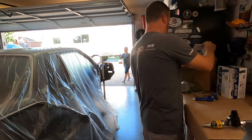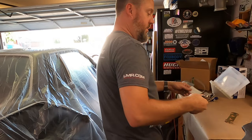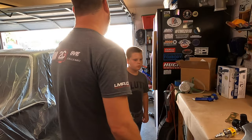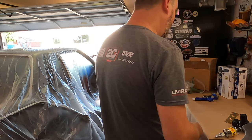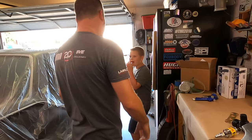What's up, man? What are you doing? Setting up this. Is that paint? That's a paint gun. Cool. Yeah. Snack rack? Well, it's nothing in it right now, but... Oh. Yep. Setting up the paint gun. We're shooting epoxy on. What color? Oh, it's just gray primer. Oh. But I've got to shoot the engine bay gray primer. It's pretty cool. I'm going to set the whole garage up as a paint booth. I've got to put walls here. Well, at least covering up the bike and refrigerator. Get the Mustang out, and then I'm putting fans along the bottom of the wall of the garage door. So I've got three box fans in the truck we're going to set up. Why are you going to set them up? Suck the dirty air out. Which means when I do this, I'll probably do it on the weekend when you kids aren't around.